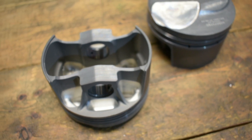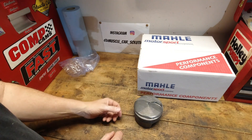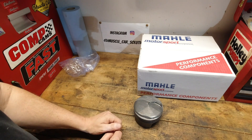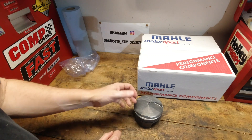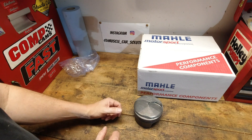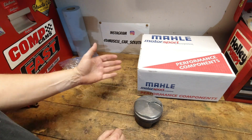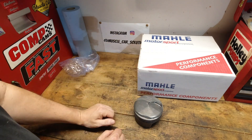The 4032 material in the same type of piston is typically just a little bit lighter, so sometimes folks will opt for that if they're willing to take the risk of getting the tune wrong. The 4032 is a really good street/strip piston. They wear a little bit better — the 4032 has better wear capability than the 2618, so the 2618 tends to wear out a little faster. But in a racing application you're not trying to get 50, 60, 70,000 miles on it — you're looking for a number of passes or seasons before you change the piston out or rebore.